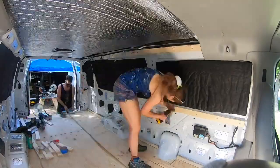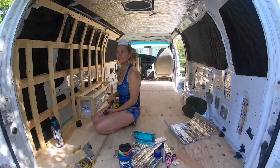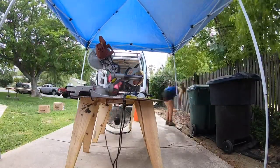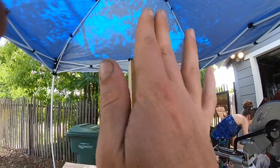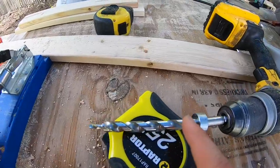We're going to take all the old existing framing out. In our step-by-step how-to-build-a-van video, framing is like the fifth step. We need to get our layout down — we just kind of broke ground, didn't get too deep, just some things going. Danny's already taking it apart. I'm making a cut list — I already cut these; this helps your framing go quicker so you can just chop everything. The key tool for framing is a Kreg jig, which helps attach framing through a countersink screw with a little drill hole.